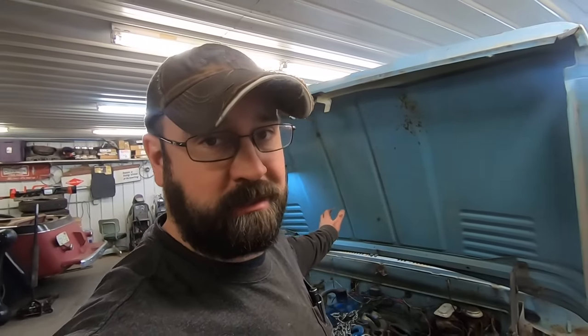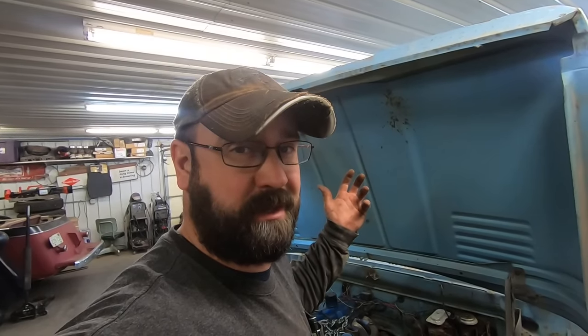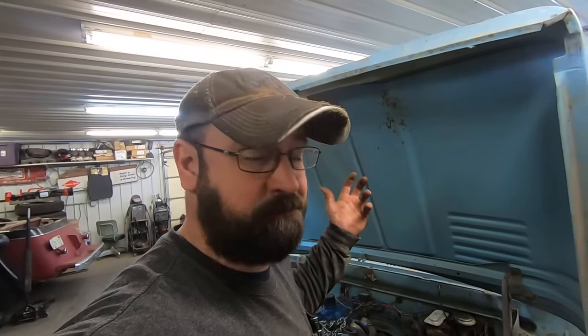All right, so we got pretty much everything wrapped up here. Looks like it didn't even take a half hour, and that was half the time spent grabbing tools and drain pans and everything else. Engine mount's done, cooling system's drained, exhaust is unhooked, carburetor's all undone, wiring's all undone. Got the slave cylinder just kind of set off to the side, so that way we don't have to bleed that again, because anybody who's ever bled a hydraulic clutch knows that they suck. Maybe I just suck at it. So we're trying to keep the suckage to a minimum.